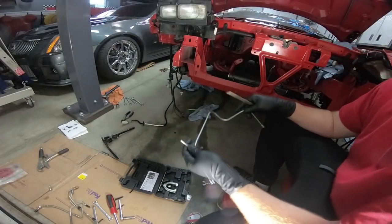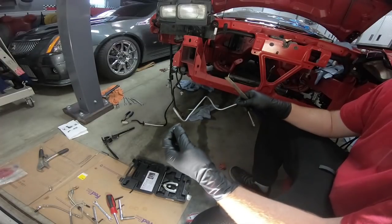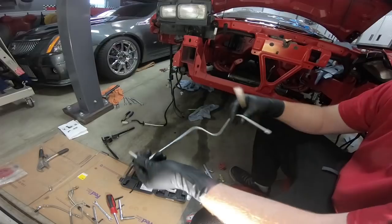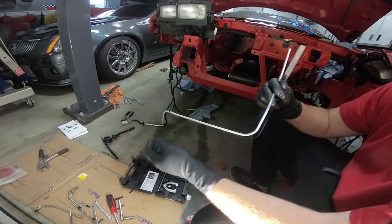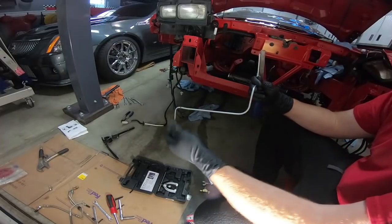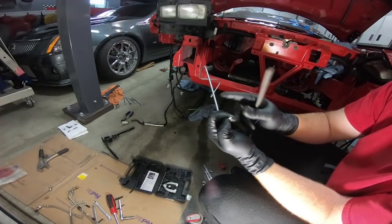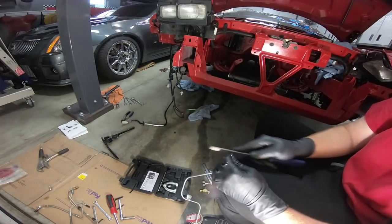I have my flaring tool out now. First of all, put your fitting on first — that is the most important thing. I did trim a little more off this line, the one that came out of the actual solenoid going down to the tee. I wanted it to set up a little further. Anytime you trim some off before you flare it, it's a good idea to use a deburring tool. I don't actually have one, so I'm just going to use a file and file down the end.